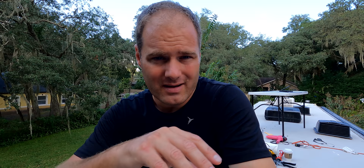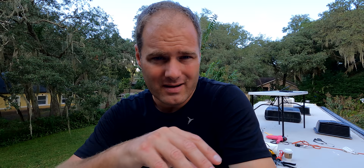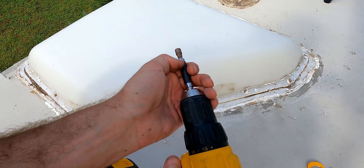After seeing the rusted screw and the water that seeped around the whole skylight, I'm tempted to pull the whole skylight up just to make sure the wood and everything underneath is in good shape and I don't have to replace any of the wood. Also, I want to make sure it's clean underneath so I can silicone around the edges, making sure there's a good seal so that in the future if stuff gets past the lap sealant it doesn't go into the RV. I want to seal underneath and on top for double protection.